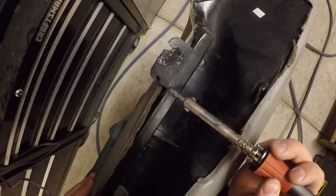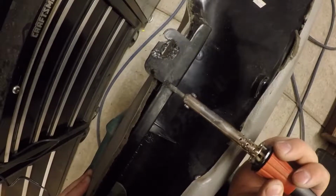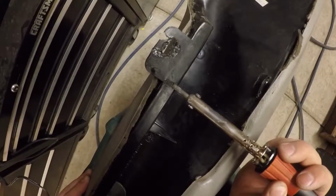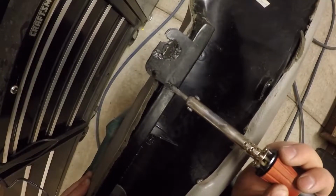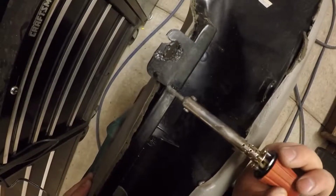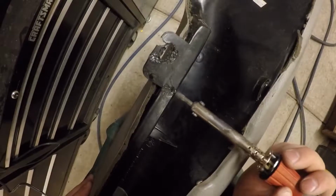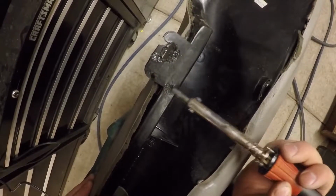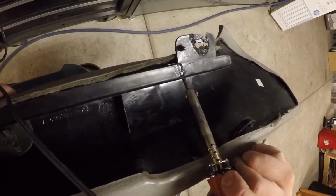This is a little bit thicker plastic, so I can show you a little better how I typically do this. You can see I'm kneading this together as I go through, making sure I get both sides hot. Then you can come in later and smooth it out once you've got that plastic together nicely. I've got a crack on this one all the way down into this area, so I'm going to do this all the way through here.